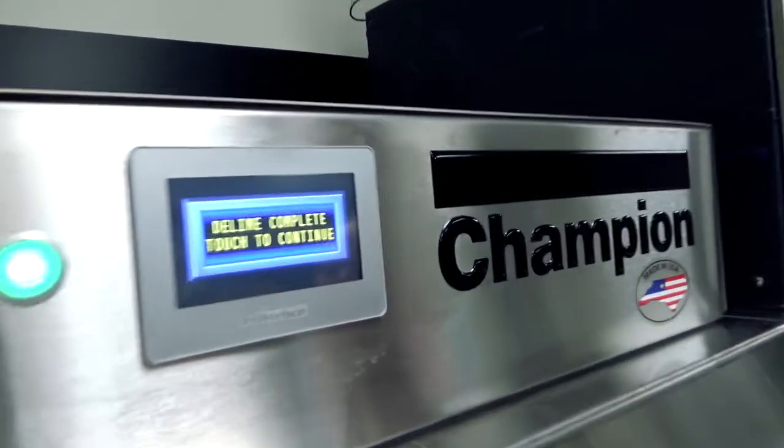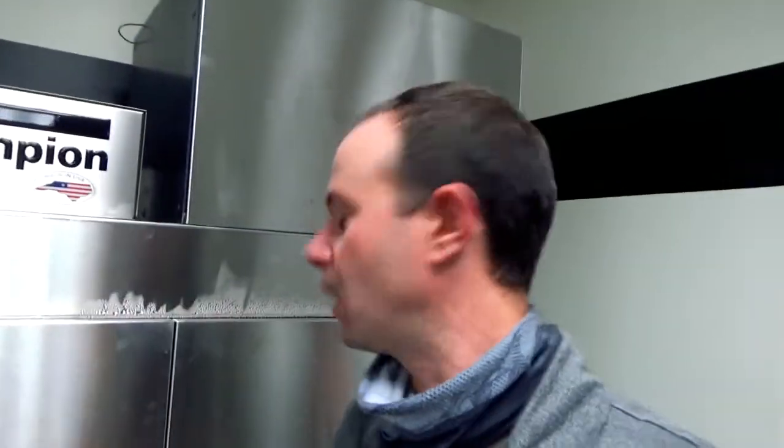We've just finished the last step of the de-liming process. The machine just drained after the final de-lime rinse and the screen now shows 'de-lime complete — touch to continue.' But don't touch that yet, because we haven't put the final rinse arms back in. Open up the doors and you've got a nice, clean machine. Pull those rinse arms out from the scrap screens, reinstall them, and while you're in there, take a look around to make sure the de-lime process did its job. If there's still lime scale buildup, run another cycle or increase the de-lime wash time — maybe 35 or 45 minutes instead of 25.